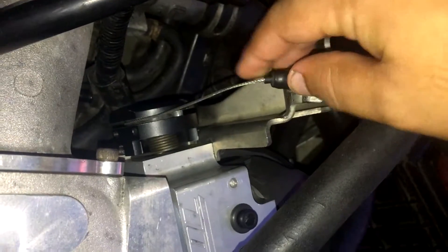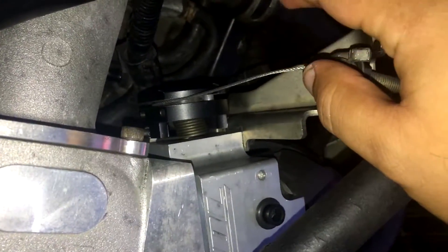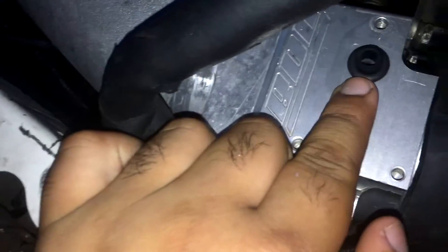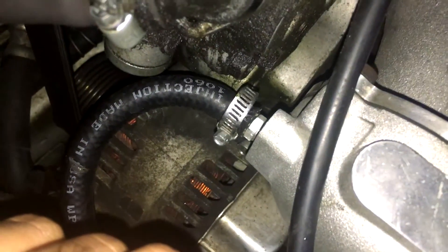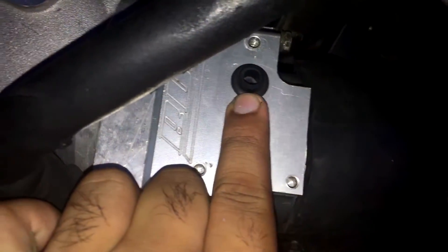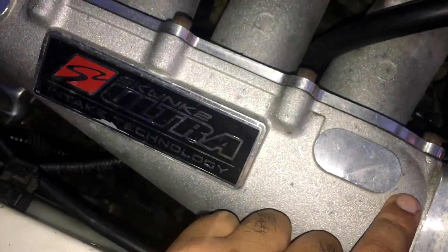There's how the engine is looking. I had to bend the throttle cable because the cable wasn't stiff enough — it's kind of bent right now but it's just a temporary fix until I get that sorted out. The other thing I was having problems with was the MAP sensor. It's supposed to be here but I moved it today. Long story short, that sensor could go there but it wasn't getting enough signal because this intake manifold doesn't have a hole for the MAP sensor, so I had to relocate it here.